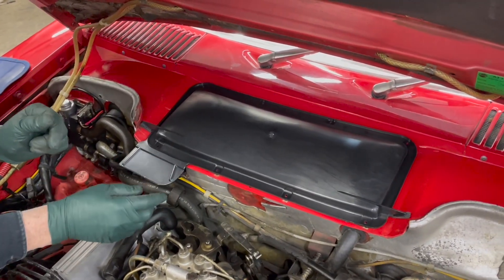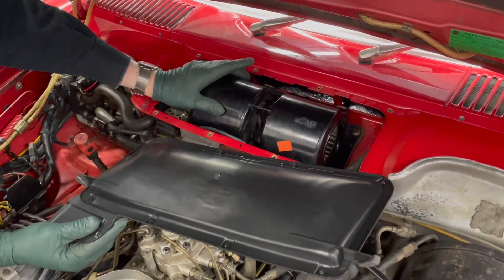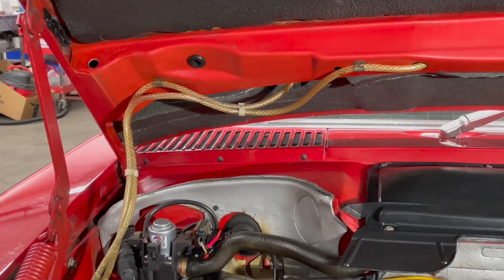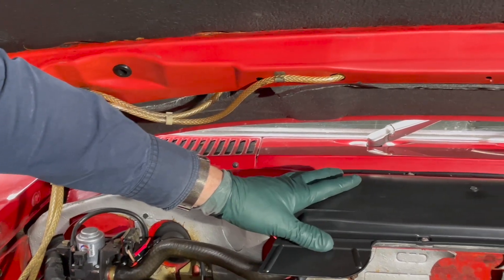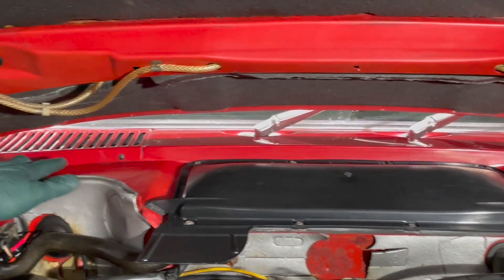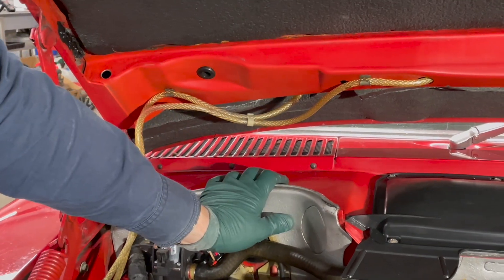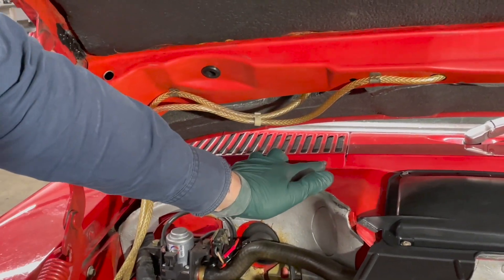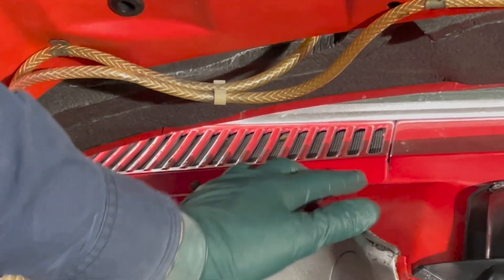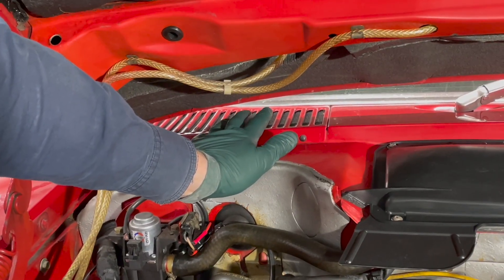You can rest in peace now knowing that you have killed the rust — because remember, rust never sleeps. If you get into this area and see considerable rust down in there, you'll also want to pull these vents. You're probably going to find rust down behind them too. These vents are held on by three plastic clips — I carry these clips on my website with instructions on how to get them off and back on. This is a very important inspection area.